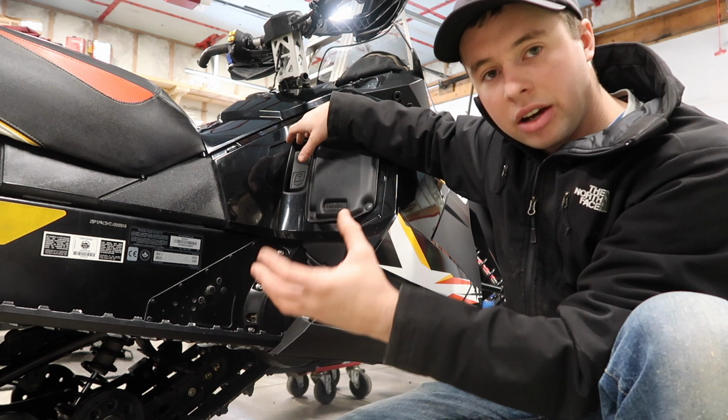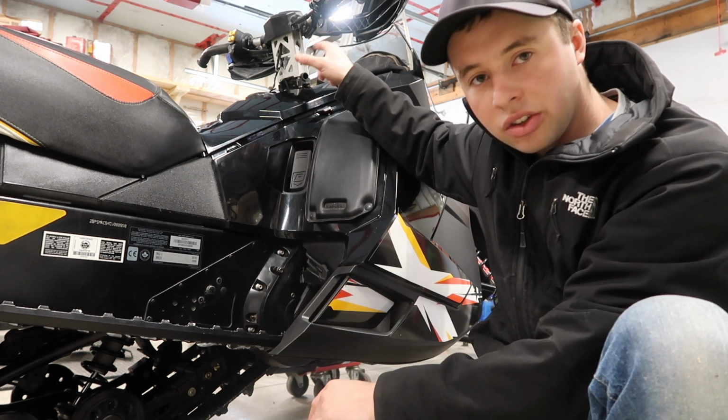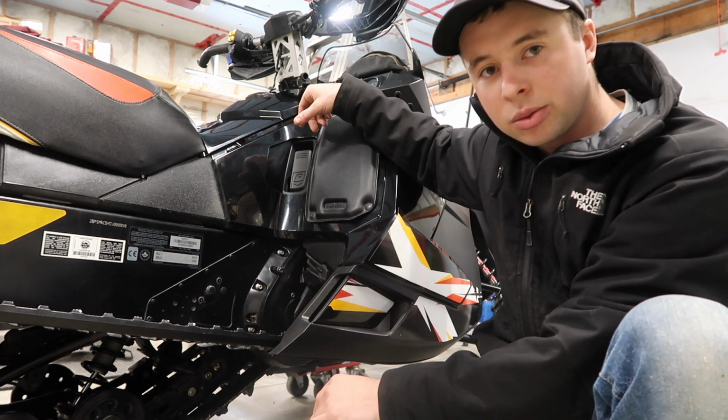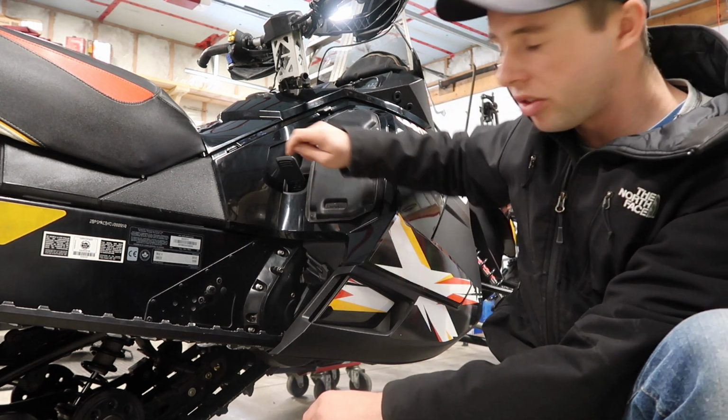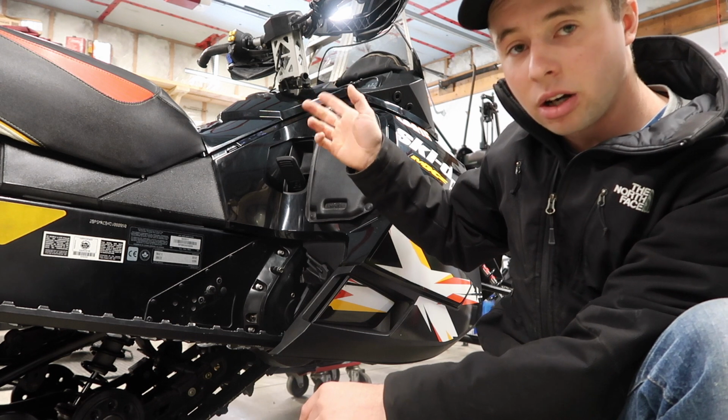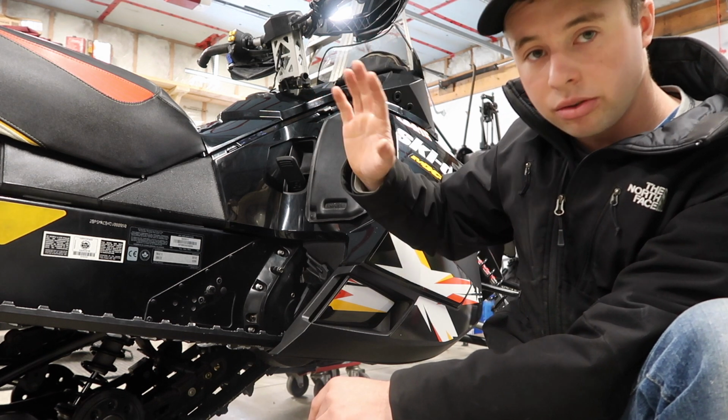But if you have it running and you have to go into reverse, you just hit the kill switch and you can pull it into reverse, just like that. Start it back up, you're in reverse, it'll let you start it in reverse, and you go backwards, you're good to go.